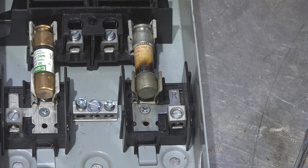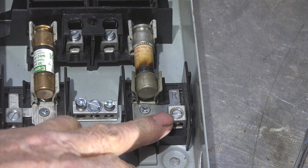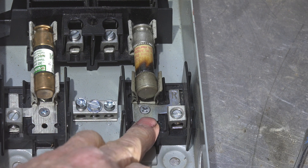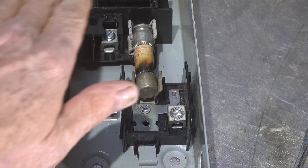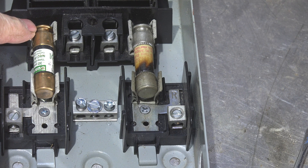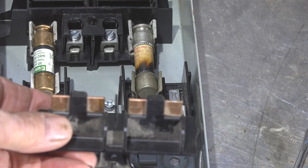However it develops - if this were discolored, I would say the wire terminal lug was loose. But it's not discolored much, not like the rest of it, and this end is not discolored either. There's nothing wrong from there up. Compare it to the other side: this all looks normal, the fuse looks good, everything's fine over there.